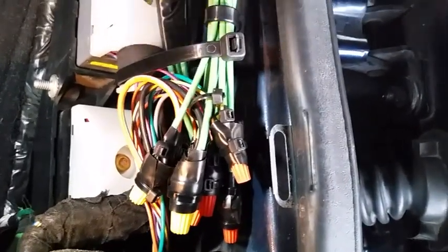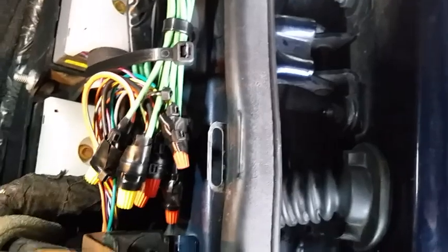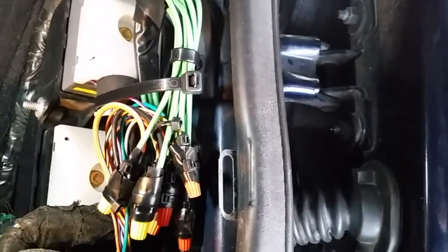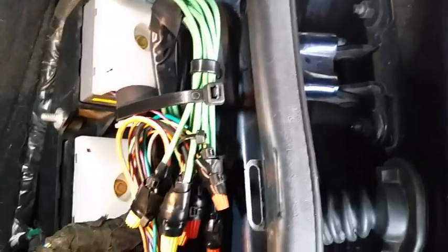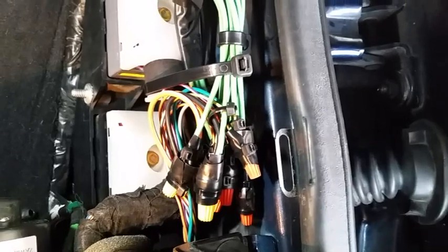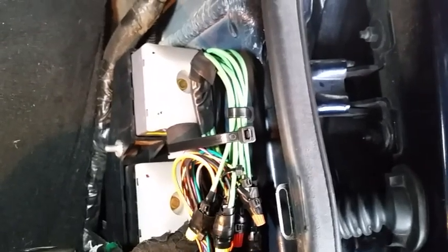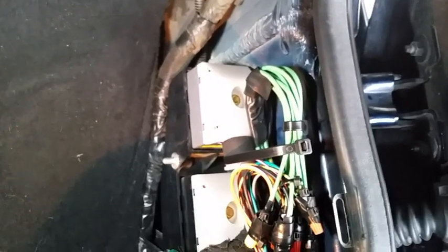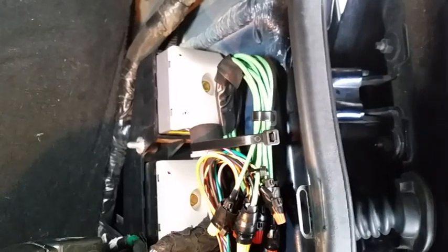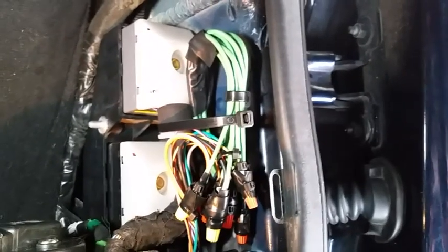So I checked all the things, which is the door lock, power mirrors, all the positions, up, down, left, right, a window up and down, door lock and unlock, speaker, radio, so turn the balance all the way over to the right. Yes, it checks good. So all the functions of this door work fine. And that means all the connections were made correctly and nothing's loose. So you can QC your work before you finalize and put the body panels or the interior panels back together. That way, at least that much work is saved, before you tie it up permanently, well, not permanently, but with the tie wraps, and then check it again to make sure nothing came loose.